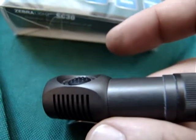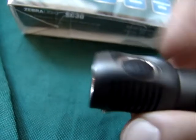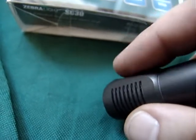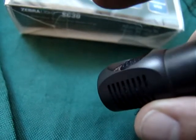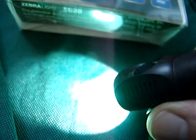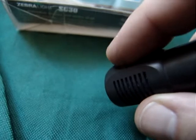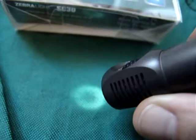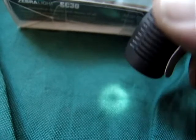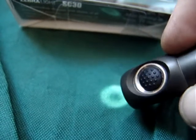As far as operation is concerned, I like the operation on this - it's very simple, all from one button. From an off position, if you want to come straight into high mode, you just press and let go and that will come instantly into high mode. From any mode to switch off, you simply press it again. If you want to come into low mode straight away, you simply press and hold for one second, and it's now in the very low mode - this is 0.4 lumens, which has a 21 day run time.